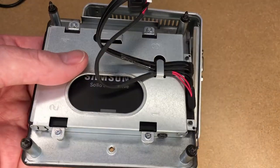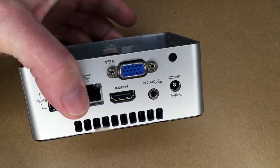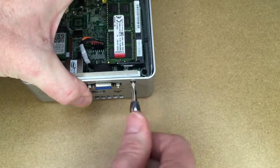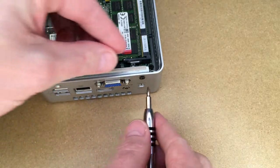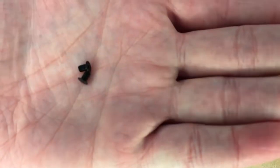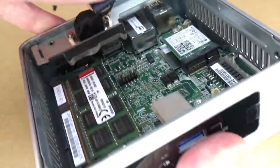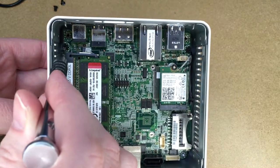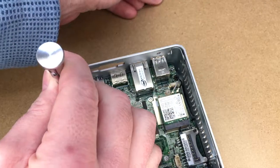If you want to take the hard drive out, you can just remove the four screws around the perimeter and it comes out pretty easy. Next I'll take off the VGA port — that uses a number one Phillips bit. There are two screws. There's one connector here — just pull it up and it comes right off. Inside the case we also have two screws, one here and one here. Keep all the VGA header screws with the VGA header so you don't mix them up.